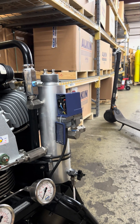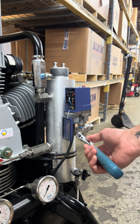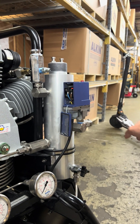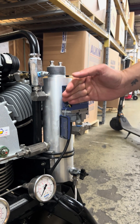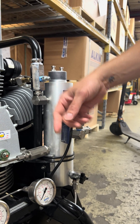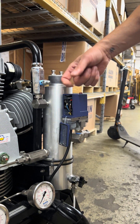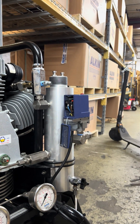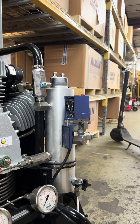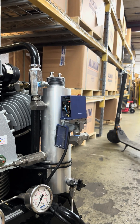The next step is buying an adjustable wrench. You have to basically turn this down, so this pressure switch comes to this angle so you can remove it. You will have enough clearance here. Right now it's not going to turn because of the purifier, but if you bring this down 90 degrees this way, you will be able to remove it.